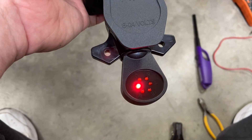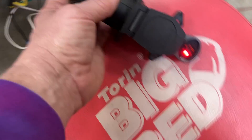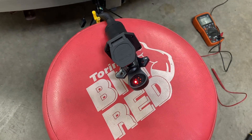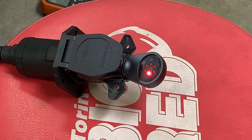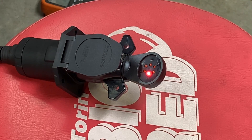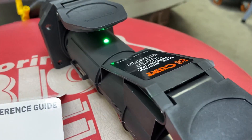I've got my tester in here for the seven-pin. I don't have the wireless controller in here yet, but let's make sure everything else works correctly. We'll try the signals and the brakes and see if the signal is passing through the seven-pin connector. I hooked a fuse up in front where the battery is, and this shows we've got our constant 12 volts going to the connector. Now we'll try the signals — left turn signal, right turn signal, and brake. Looks like everything's working. When setting it up, this little light underneath flashes blue, and when connected it goes to green so you know you're set up.